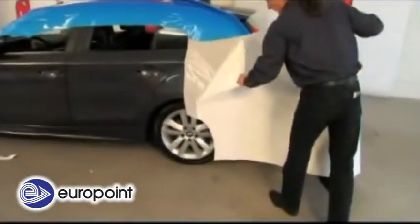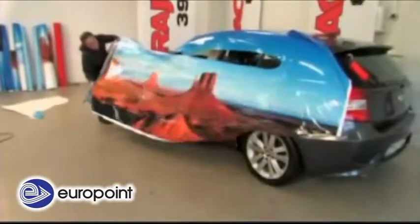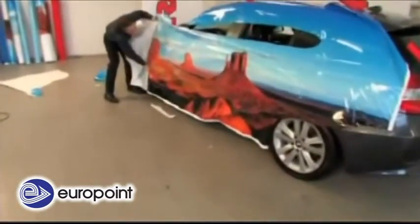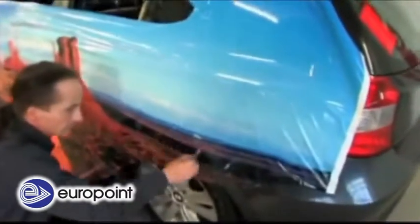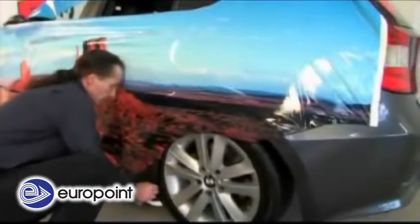The width of vinyl is then folded over, working from the left side to the right, and a further 1/3 of the silicone paper is pulled away and cut off. The vinyl width is then, carefully and with slight tension, laid across the vehicle and evenly pressed into place with the squeegee at curved and rounded places, as described for the preceding steps.